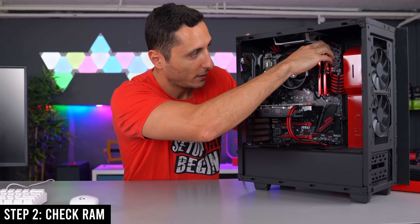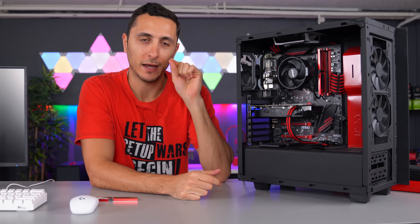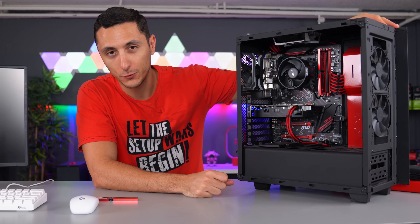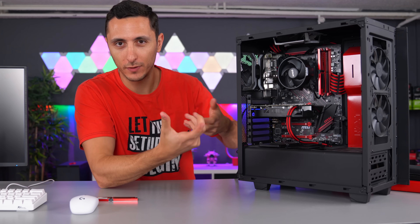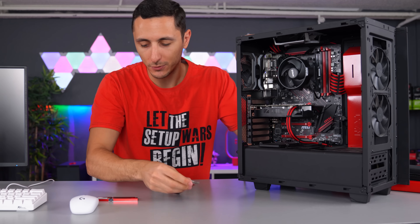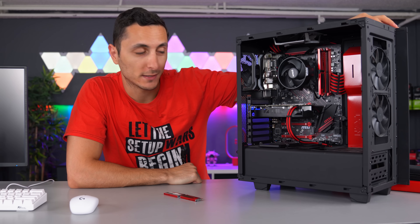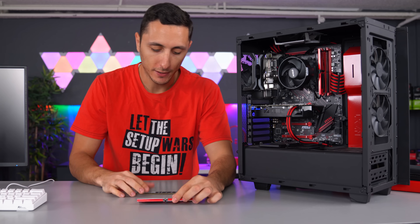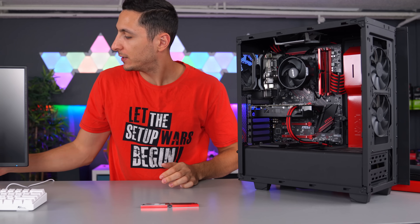In this case, we're going to test one RAM stick at a time. Take off the second one, keep the first one in. Every time you retest the system, you've got to do a power drain — disconnect everything from the PC and hold the power button for 20 seconds. That drains the flea power or static electricity from the system. Always do that before testing after removing or putting in new parts. Same result. Now we're going to swap the RAM sticks. For the sake of simplifying this video, I'm going through the entire process step by step. Same result again. If you don't have any spare RAM lying around, that's fine — just leave that stick in there and move on.